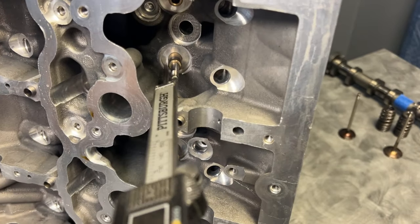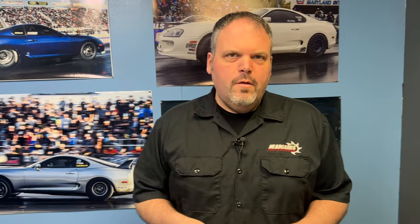Same thing here — 1.690. It's important to do this because if you're installing your own spring kit, you should measure everything. By measuring the stem height you can figure out your spring height, and if you know your spring height you know you're installed at the correct height — just throwing parts in does not make sense. What I've found is that the stem height is actually within ten thousandths of OEM, so we're good. I'm going to guess they put seats in because they had to go from an oversize to a stock-size valve. They kind of ruined it, but we're going to fix it — valve job the head, fix these parts, and put some good parts in it.